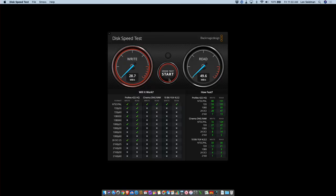If you opt to encrypt the volume, you will see a pretty significant performance hit. Running that same test connected to an encrypted share, write speeds drop to about 27 megabytes per second and read speeds drop about in half. The reason is that the processor has to do more work to encrypt and decrypt the data, resulting in lower throughput. So you'll probably not want to use encryption if you want the best performance, but without it there's a risk someone could pull a drive and read the data. It's a bit of a balancing act between security and performance.